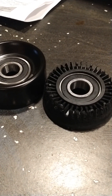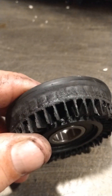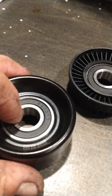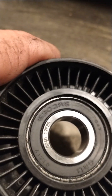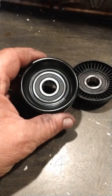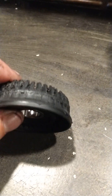Check it out — 2003 Ford Focus, the idler pulley went bad. The bearing was still good, but it had five grooves in it like a belt. The part number is 6203RS. This same number is used in the computer for both the tensioner arm and the idler arm, so if you're not careful they'll give you the wrong one, which has grooves in it.